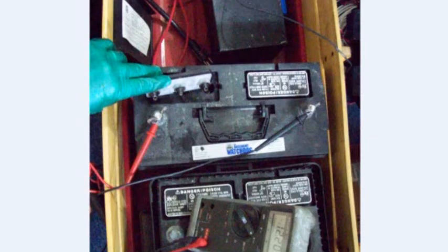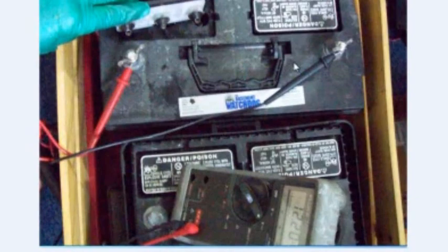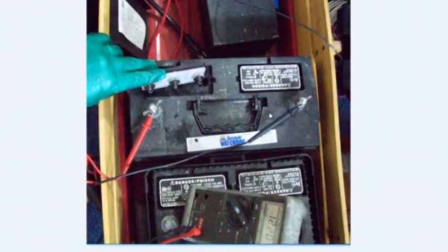What you're seeing here is a voltmeter attached to the plus and minus of a battery. The only way this will work is that the battery has to be totally unplugged from the device for a minimum of 24 hours. I let this one sit for two solid days, put the multimeter to it, and I read 12.2 volts. This is not a very precise measurement but it gets us a relatively close state of charge.